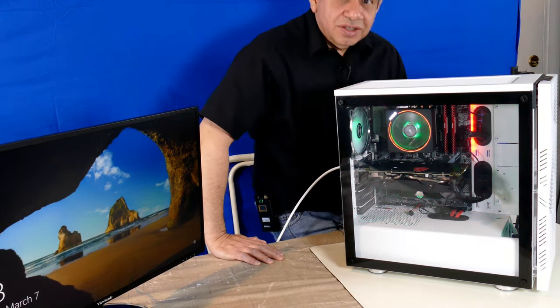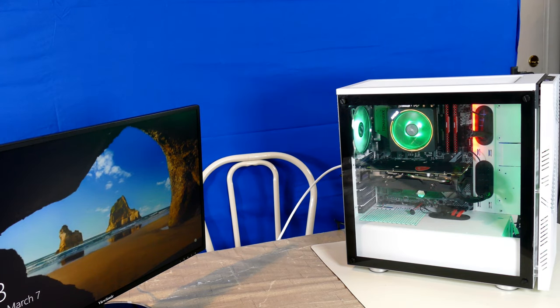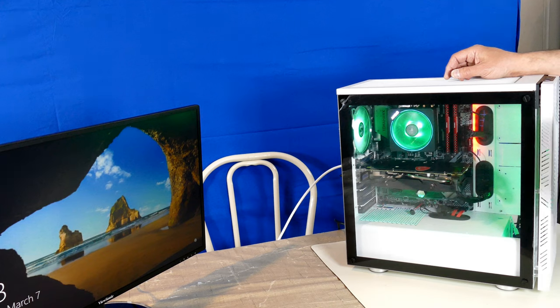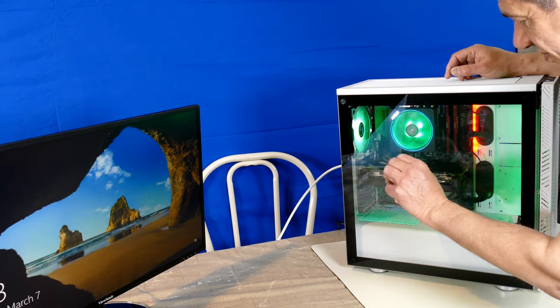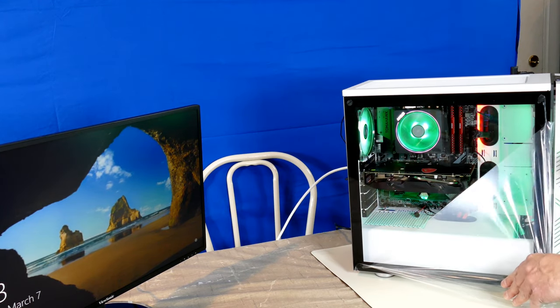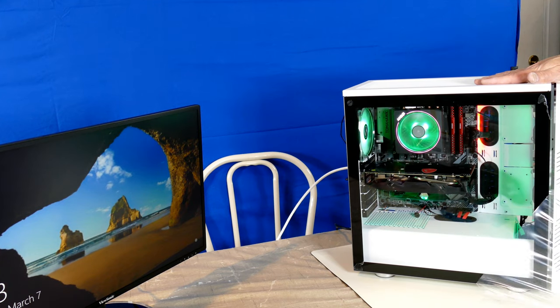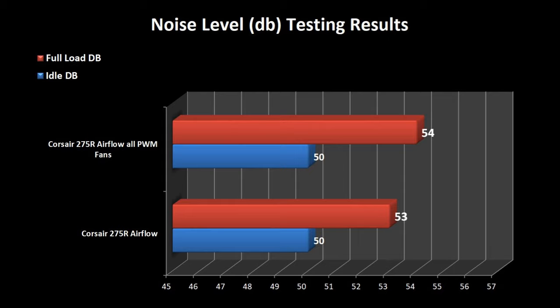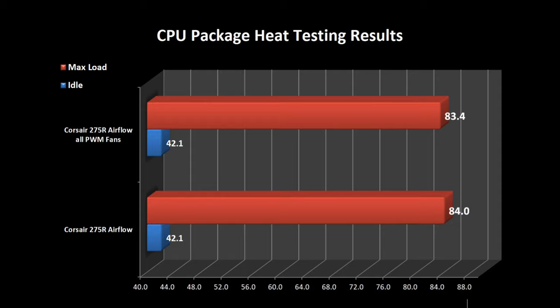I just realized I did not do the tempered glass protector tear, so let me go ahead and do that — I know that's an important thing for everybody to see. Let me peel off the edge here, get around that screw. I left the screw a little too loose and it popped off, but not bad at all. Let's do some system testing. In terms of noise testing, it didn't change that much — it got one dB louder, which is expected when you have PWM fans. In terms of heat testing, it actually cooled down about six-tenths of a degree centigrade, which is an improvement — again, what you'd expect when you put in PWM fans.